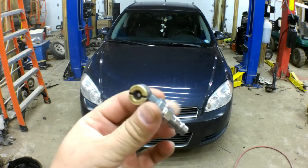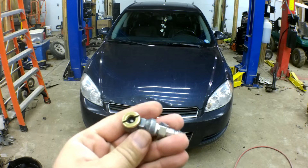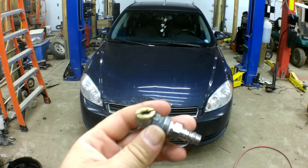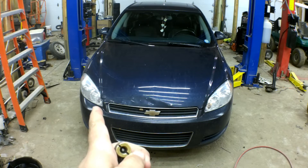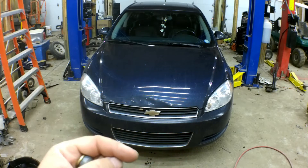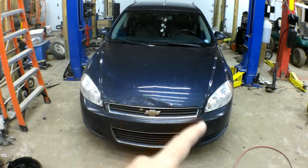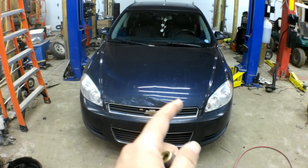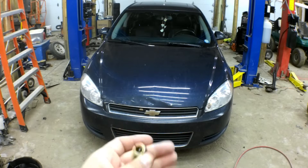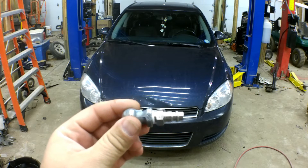Then what I'm going to do is take an air chuck and let air out of that tire until the horn honks. After the horn honks, you're going to see that light light up. We're going to do the same thing all the way around the car in succession until we get to the driver's side rear. At that point, all the TPMS will be programmed, and then we can set the tire pressure because I'm actually going to let a little bit of air out of the tires doing this.